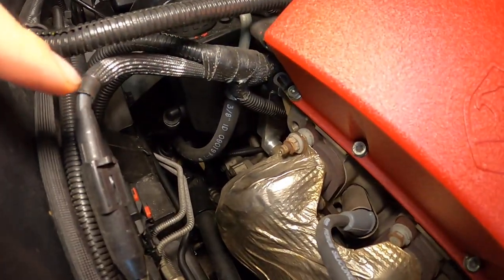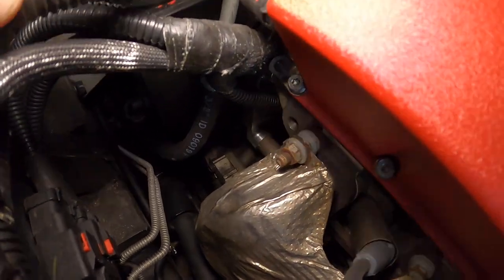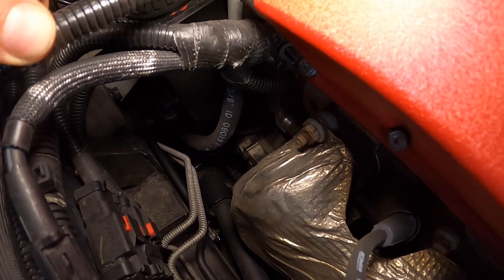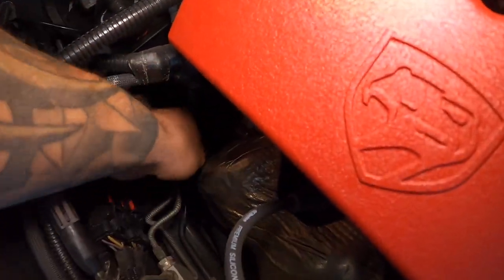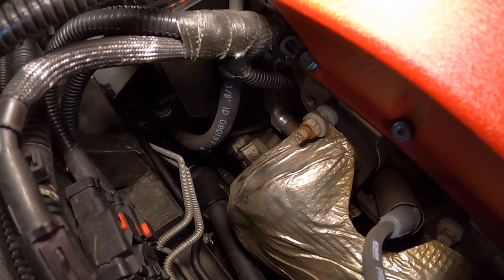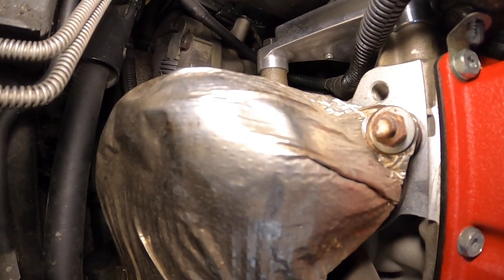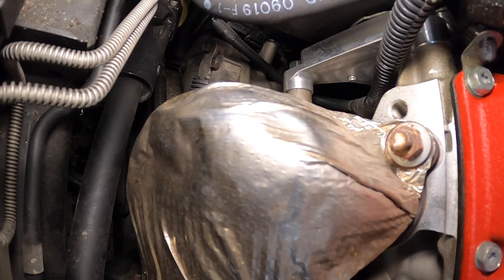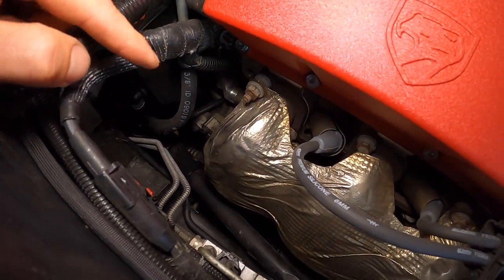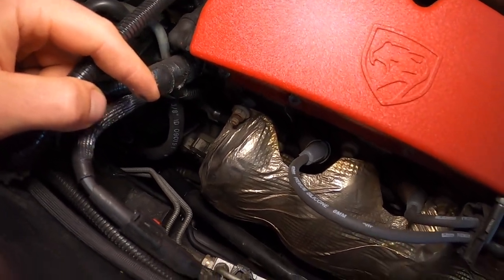If you look right down here, you'll see a 10mm bolt right there and one next to it — those are the two lines that go into the AC compressor. We have to take those two 10mm bolts off and pop those guys off. There's going to be two O-rings, one on each line. There is enough room to get your hand in here, though it's not the most room. I'm going to spray some brake clean on that area — I can see a little bit of green around there, so it does look like that is my issue, which is what everybody reported on the forums as well.